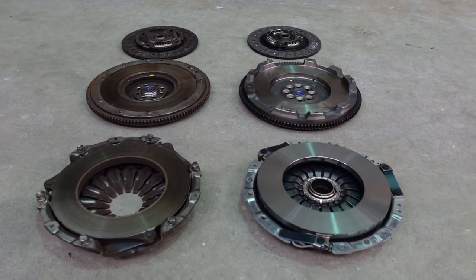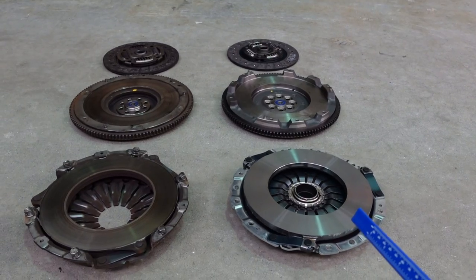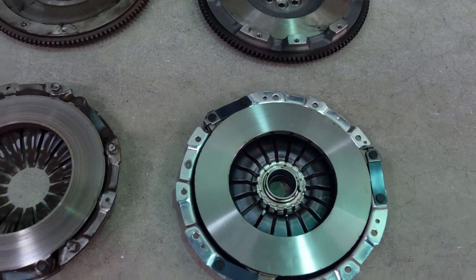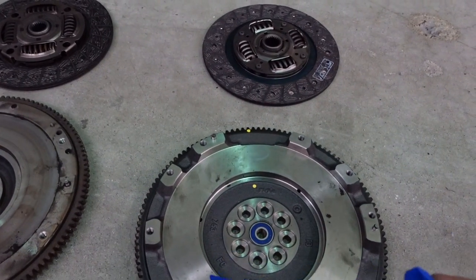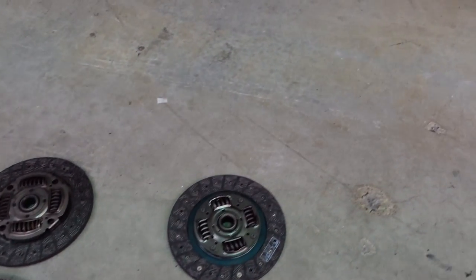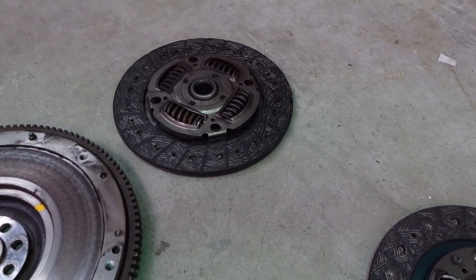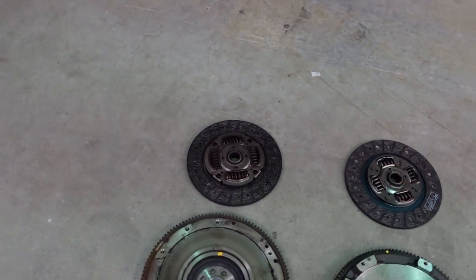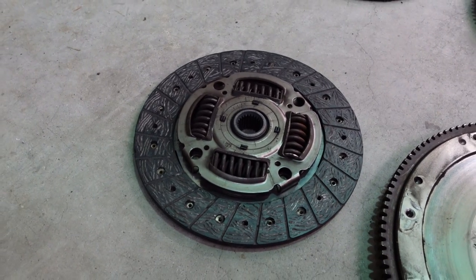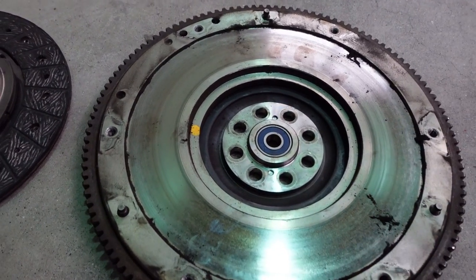It's neat to see the differences between the STI and WRX flywheels and clutches. On this side we have the new STI stuff going in and on this side we have the WRX. One is more worn than the other, but the flywheel surface area where the clutch disc makes contact is actually the same between the two. The friction surface area on the clutch discs is also pretty much the same. In spite of our time attack use, the WRX clutch is quite a stout unit — there's really hardly any wear on it. It looks like it had a lot of life left in it, and even the flywheel surface looked quite good.